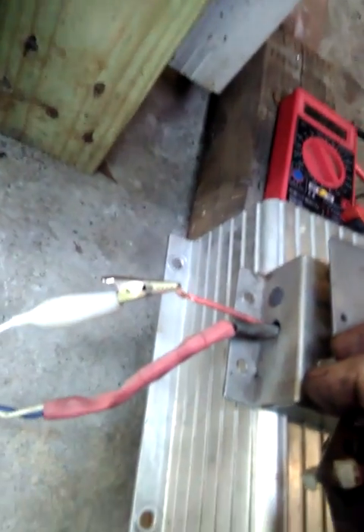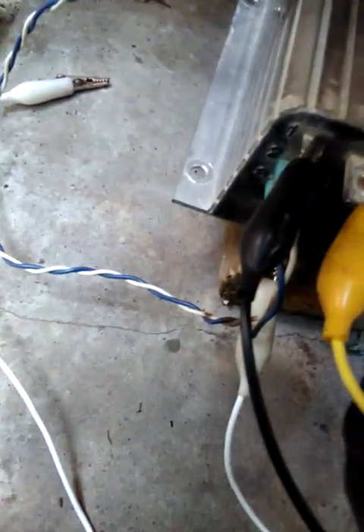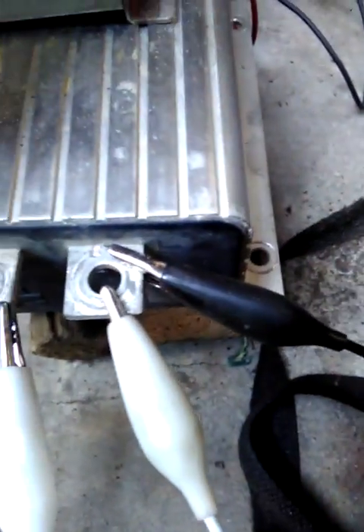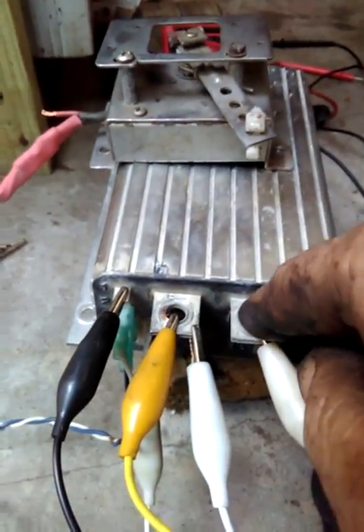I've got one of the potentiometer wires going to ground. The wiper seems to be on pin number three and the other wire seems to be on pin number two. Our regular setup means pin number one goes to B-plus to turn it on. I have a yellow terminal here for B-minus, and I also ran that other wire over to ground for the potentiometer. B-plus goes here, and our motor also connects here.